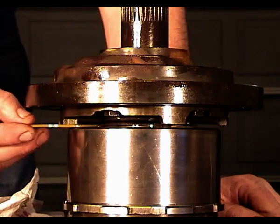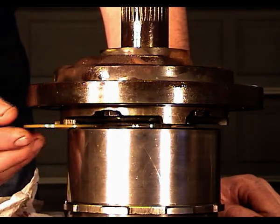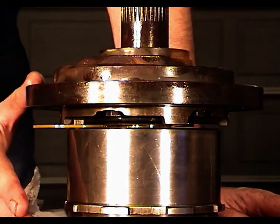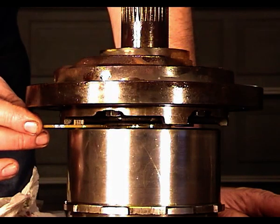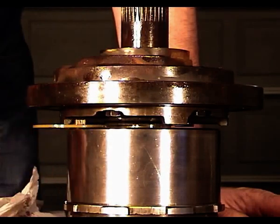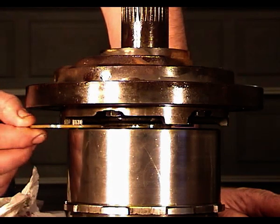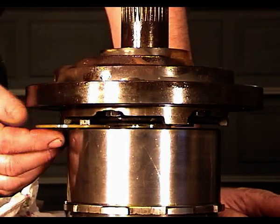Let's try a slightly thicker one. I'll put that right in here — it actually has maybe just a slight drag, but it's not lifting the pump. If there's so much drag that the pump actually lifts up out of the clutch drums, it's too thick. We don't want this thrust washer to take the entire load of the rotating assembly; we want the number two thrust washer to do that. We only want this one to take the slack out of the drum to keep it from walking back and forth. That one looks like it's going to be perfect. If I wind up having to change the number two thrust washer to get my end play right, I'll need to recheck this and determine which thrust washer in the number one position will fit the bill.